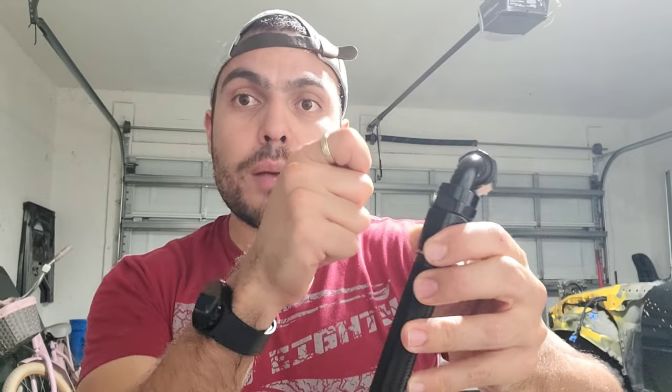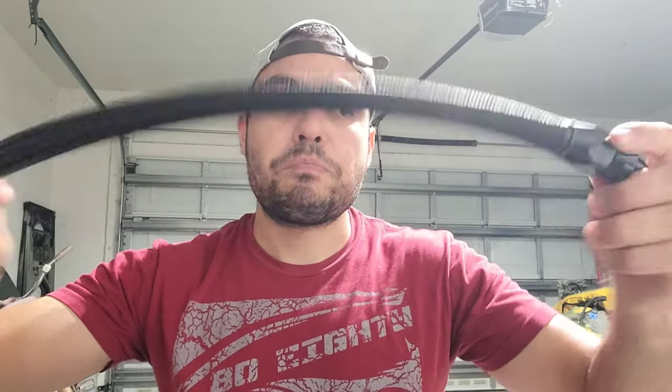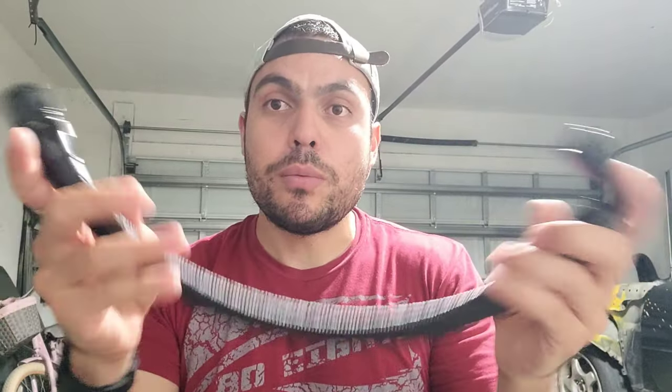These fittings have an inner lip, so it actually stops the hose from going over, and then it's threaded on the inside after the lip, so that you can thread the port inside. As you're threading it in, it's actually going into the hose, and there you have it. You just screw it on to wherever it's going to go. So really nice. Check out their store.